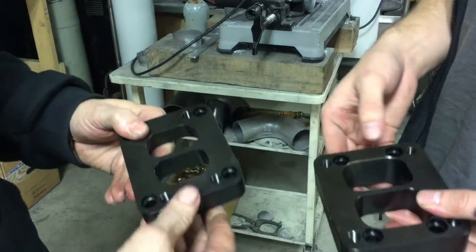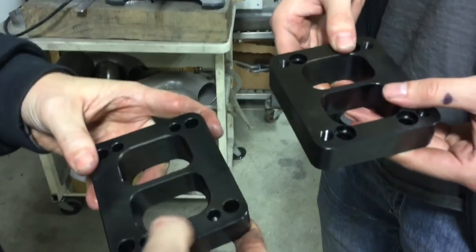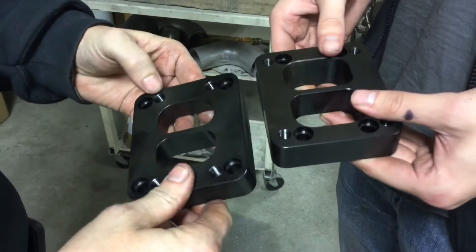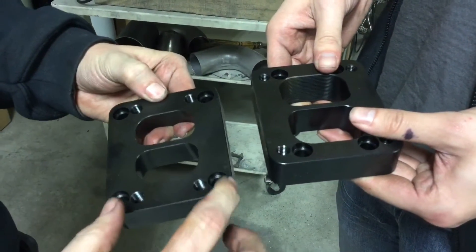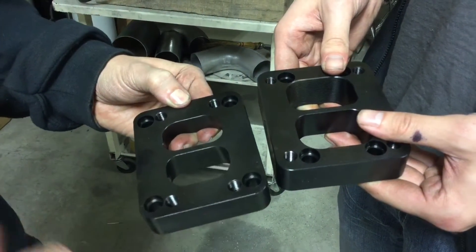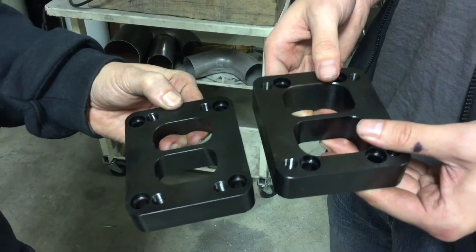So when we're switching it up, you'll notice here's your large taper on the bottom — so this is your T4 size. Here's your T3 size. So you're bolting down to the manifold here. They go flush. Gasket goes on. And there's your 3. Big to little.